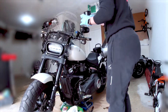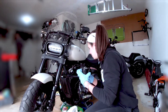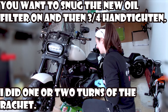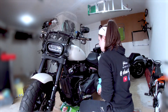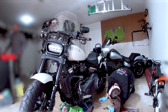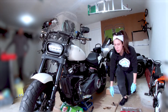The filter already comes pre-oiled around the rim. We're going to put this on — it doesn't want to be super super tight that you can't get the stupid thing off. Just snug it up — it feels like you're not tightening it but it's snugging right. Now it's time to fill her up. We're going to check the drain plug real quick, make sure it's in there snug and no residual oil has come out before we start to fill the tank with new oil. It looks good underneath — I don't see anything dripping.